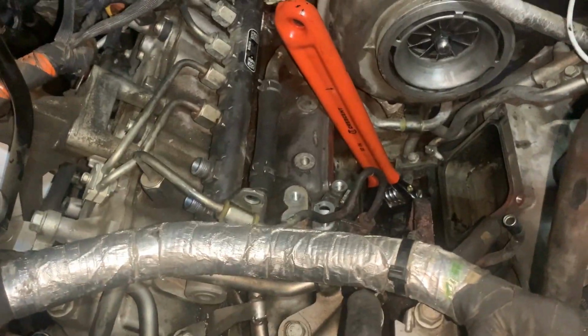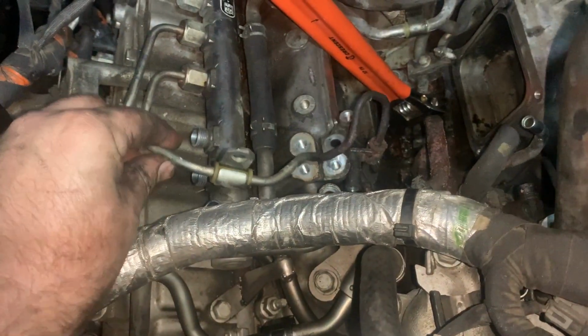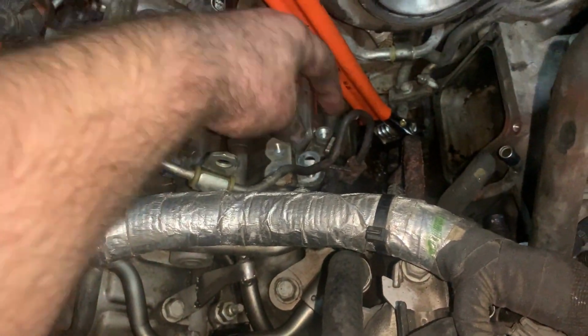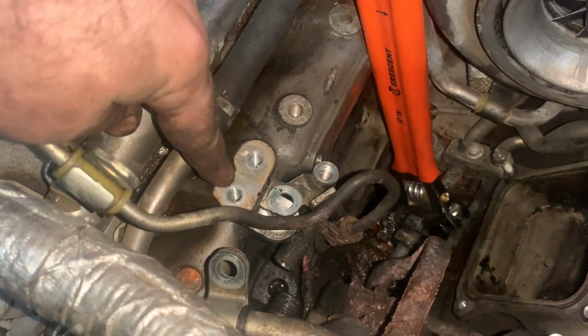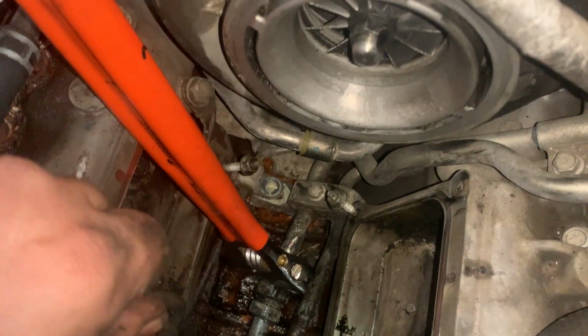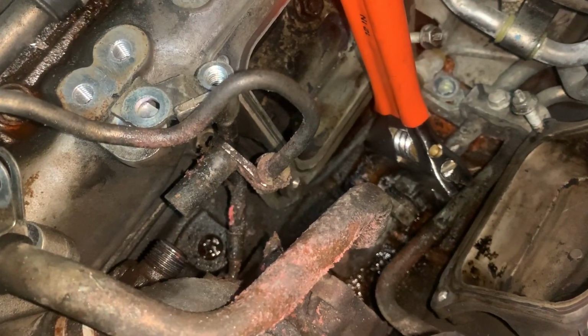All right, guys, I just wanted to show this real quick. I'm still clearing out space for the pump itself to come out. This is the high pressure line. Once you undo all the mounting brackets, there's one here that goes right into the pump, and one here that goes up somewhere. Oh, that mounted to the big thing that I have screwed in there. And once you undo that bottom one down there, that gives it a bunch of play to move, and it scooted over pretty easily.